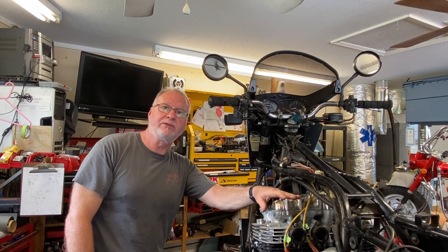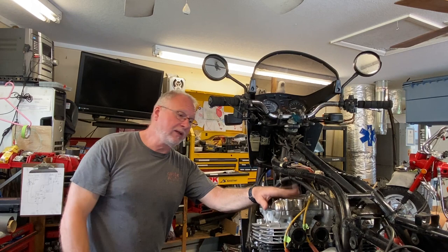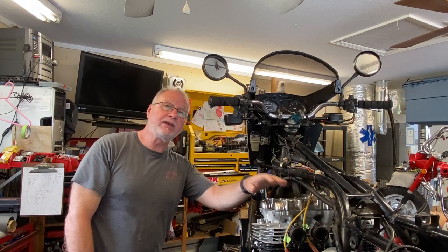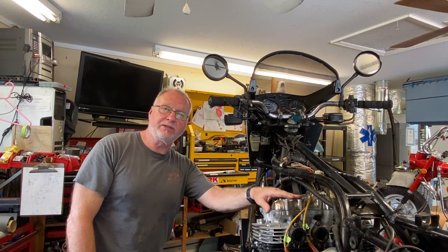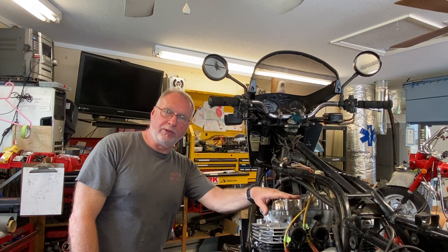Yeah, that's a problem. Now the next video we're going to do, because this one's already long enough, is figure out what's going on by using a leak down test. And we'll see if we have some unacceptable leakage past the rings, or if we have some top end issues in regards to the valves. That'll at least diagnose the compression, but it won't diagnose the oil consumption. But usually they go in tandem.